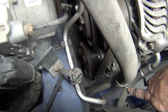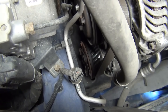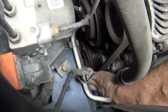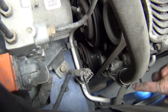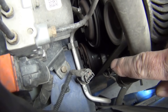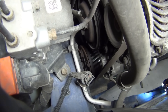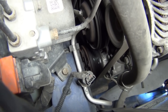This is like the final say-so — going straight to the manager and saying go. If we push power to that, it should engage together. The middle part can turn independently on a bearing. They're independent from each other until this wire gets power, and once it does they spin together in unison. The power from this belt goes from the motor crankshaft to turn the compressor, and that's what makes your high side and low side work. You have to pressurize one side to have that step-down effect that causes things to be cold.